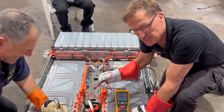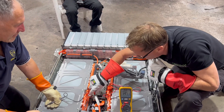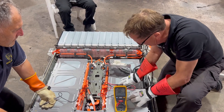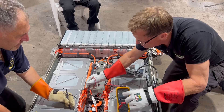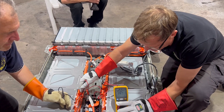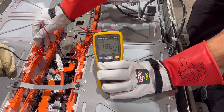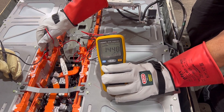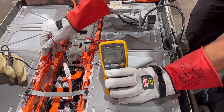We're back to doing the battery testing now. We've got the battery pack opened up and isolated into three sections. We're doing the mega test — applying 1,000 volts from the battery to chassis and looking at resistance. On pack one, we straight away get to 1,000 volts and we're at 1,300-plus megaohms — really good resistance, and it's actually increasing as we hold the button. That's what we want to see — excellent isolation from high voltage to ground.